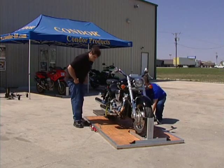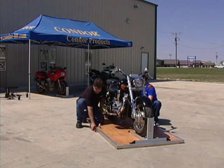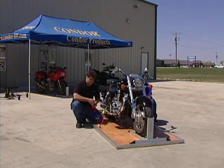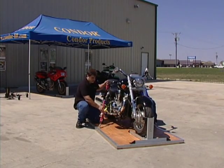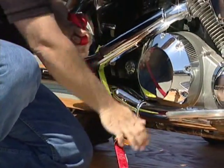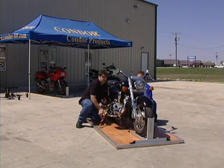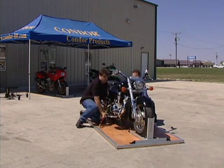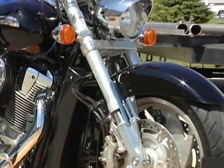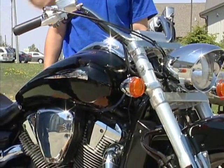And ready to be tied down. You can use as many tie-downs as you like, but we're going to show you how to do it with just two. When you are using two tie-downs, we recommend that you attach your securement points anywhere from the middle to the rear of your bike, and you load your whole machine down and slightly forward. When you load your bike in this manner, you are going to compress both front and rear suspensions but you're not going to overload either. Lateral support though is going to be quite good.